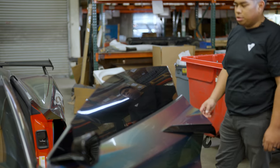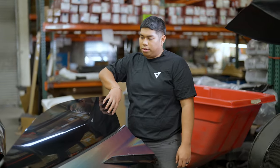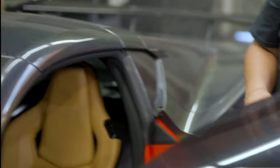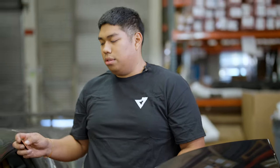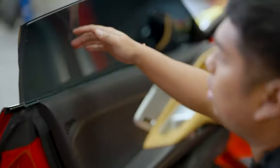I've left the film aside to prep the inside of the window. My process for prepping the window: I use a non-scratch scrub pad and a plastic or stainless steel single-edge razor blade. If you use the stainless steel, just make sure you're careful with the angle so you can install the window tint on the inside of your glass.